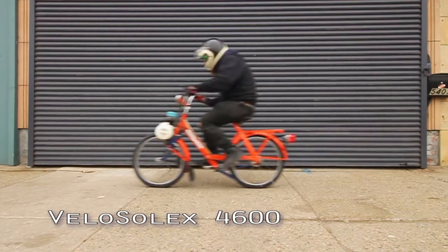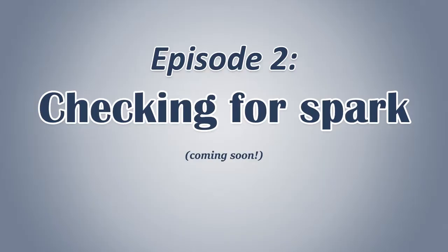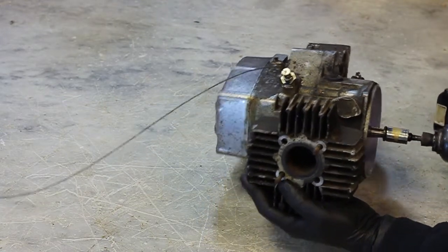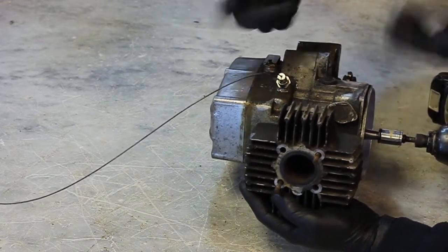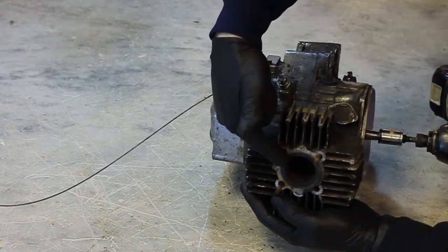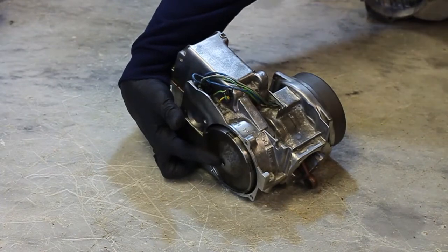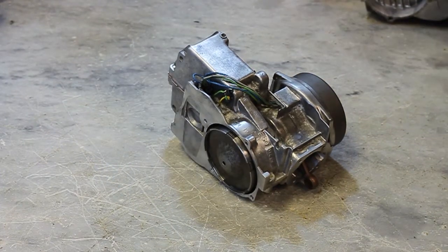If you follow the starting procedures demonstrated in this video, and you hear or feel the bike turn over, you're looking good and you should move on to the next video where we will discuss checking for spark. If you follow the steps above and you feel immediate and hard resistance preventing the bike from turning over, your bike is likely seized, meaning that your piston is locked up and your motor will not turn over. We will have a follow-up tutorial on what this means and what to do.